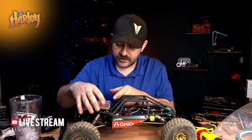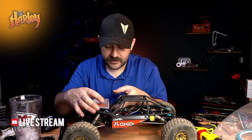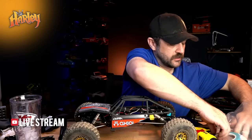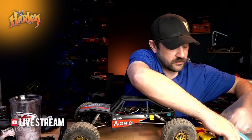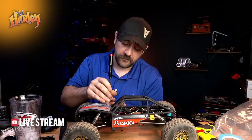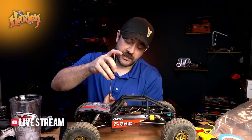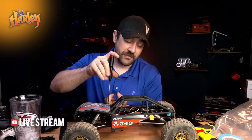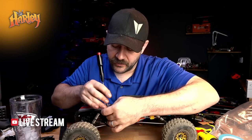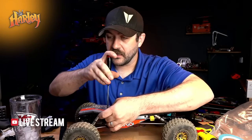But then it's just the rest of the silly stuff, like changing, you know, shooting for a 13-inch wheelbase. Well, yeah, probably around that, real close at least. Although when I bend these rear links, I may end up shorter than that because I only have a quarter inch right now, and so I don't know. Obviously I have plenty of other links as well, but this will at least give me something to compare to. I can compare my eye to eye lengths.